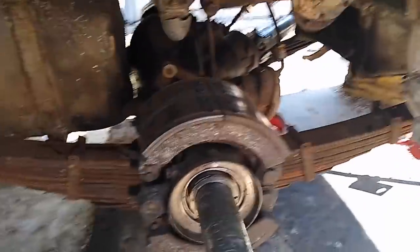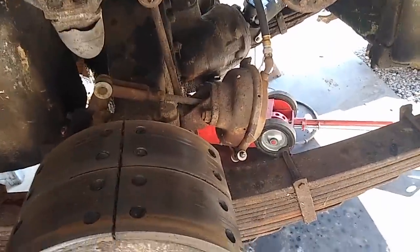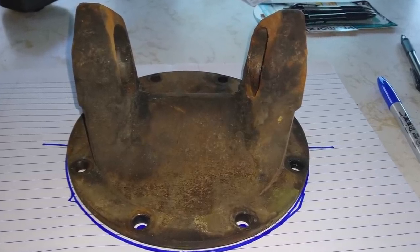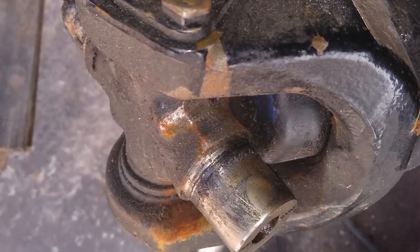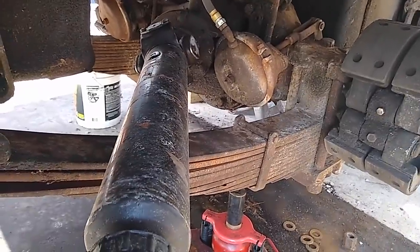My bearings are in good shape. The brake shoes from Gene Russell are sitting here and will get replaced while it's all apart. The brake cans are going to be replaced as well — we'll look at those and see if it's the right kind. One of the other big daunting things is finding a new flange. This connects to the drive shaft right here — from the transmission to the drive shaft, which turns the rear differential. That's how the bus moves.